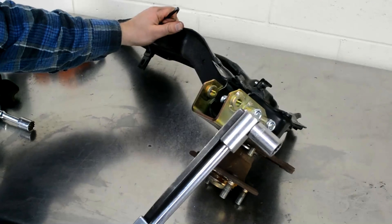The front brake setup is also super affordable, and it worked great when we went to Florida. The caliper is a CRV 2000, the brake pad is a 2004 TSX, and the rotor is a 2011 Mini Cooper base model. Unbelievable how well it performed for the cost. This is the way to go when first building a circuit car.